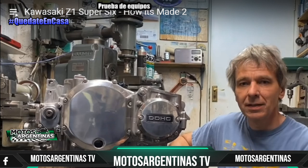So my next job is to bend over the last bend. This can be quite tricky because it has to engage nicely with the starter motor and also nicely with the engine. So I used a block of aluminium that fits nicely between the other two bends to hold it in my vise to allow me to bend over the third bend using my hammer. With the third bend complete, I removed it from the vise to have a look, and it all looks great.